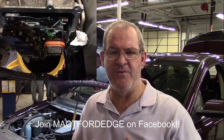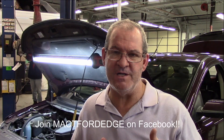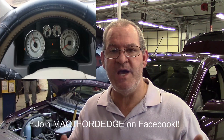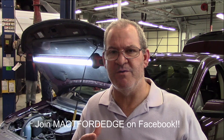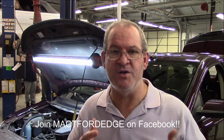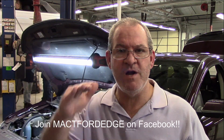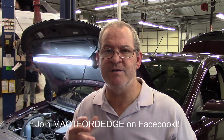What to expect: if you have a Ford Edge that's a 2007–2008 roughly, and you are at or below 100,000 miles, you will most likely have TSS and OSS failures. The first thing you're going to notice is on your dash. When they start to fail, you'll get a hard or bumpy shift when going to a stop sign, or the transmission will have a hard time shifting up into a gear. On hills up and down, you're going to have hard shifts and it's going to hunt for gears. These are all symptoms that something is going to happen.